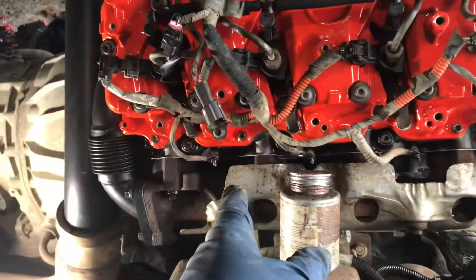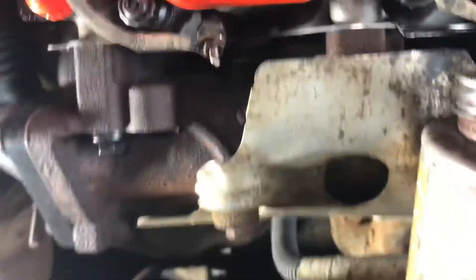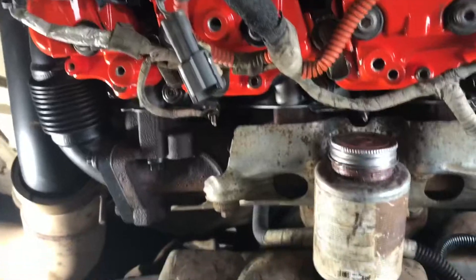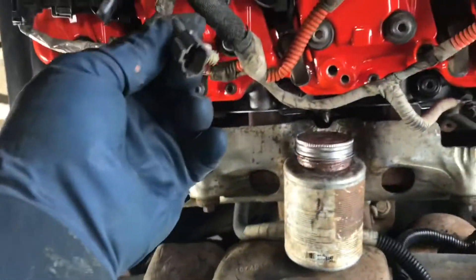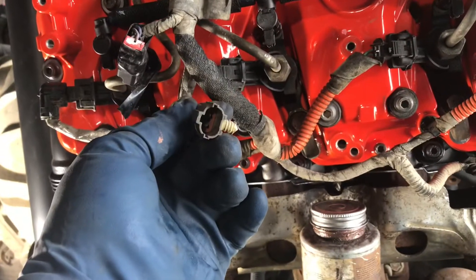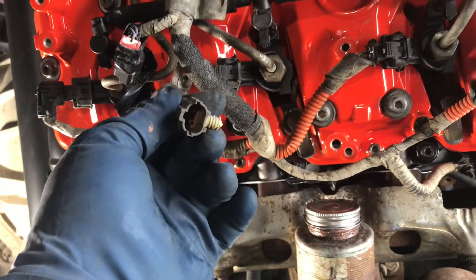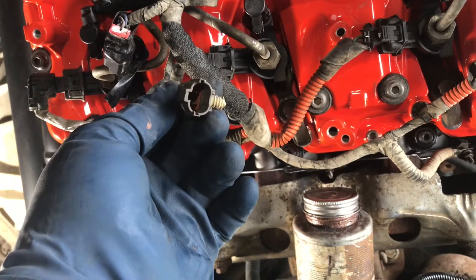Over here on the passenger side, the glow plug wires are all on — greased up, torqued up, with a little bit of dielectric, still sticking out. First I brushed them up so they're nice clean copper sticking out. The injectors are all plugged in. There's this wire here left, which goes to the fuel filter water sensor.